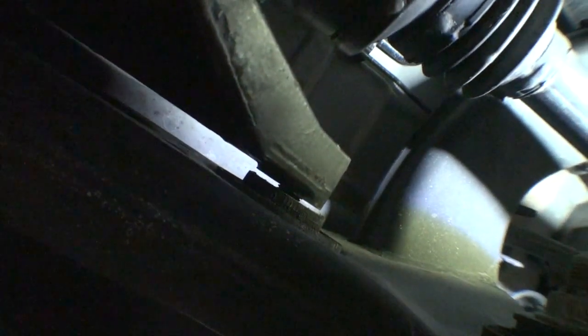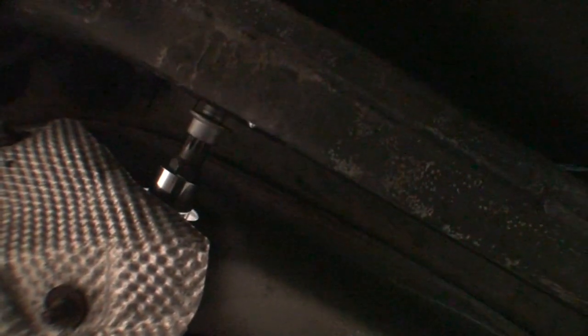So we're getting our bolts in the differential. You're going through the trunk area right there. You see the access hole. You send that bolt through the bushing and it threads into the cover right there. So here comes Gareth with the bolt threading into the bushing in the subframe. I will help you, Gareth. There we go, now we're in through the bushing. So now we've got our bolt started by hand, threading into the cover.